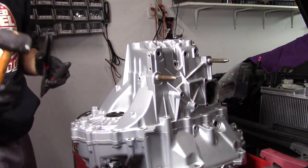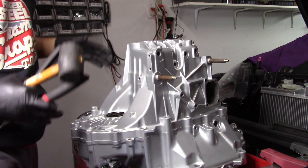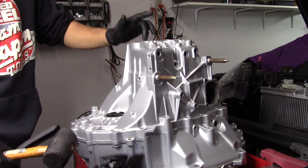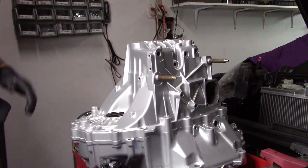So I'm almost there. Now I'm going to grab like 4 or 5 bolts and put them scattered around to close the case a little tighter. And then I'm going to show you how much more the case needs to come down in order for the snap ring to engage. I want to touch upon the RTV application, because this is a perfect example of what you want to see if you laid your RTV down right.